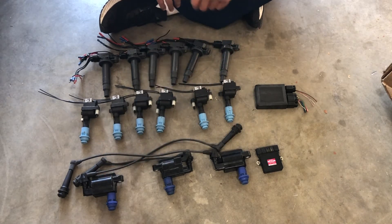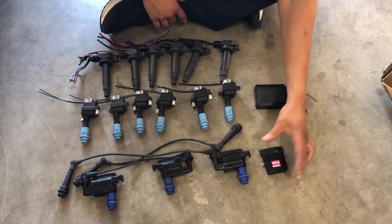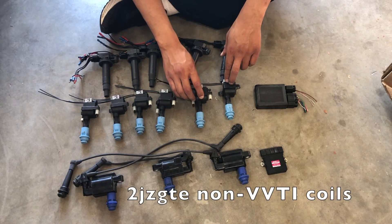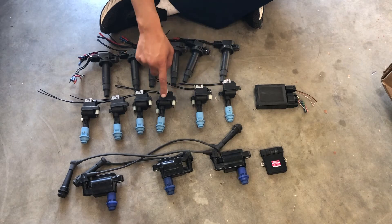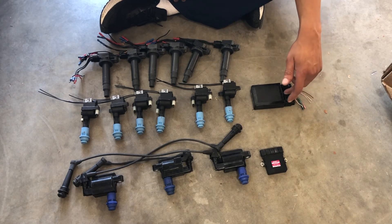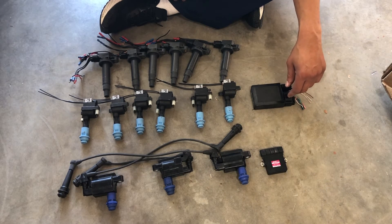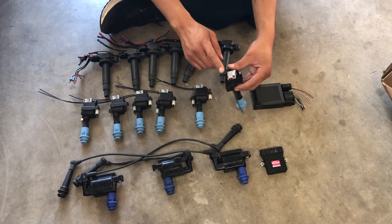Overall it's a pretty good, pretty cheap setup. These are eBay coils that have worked great — I picked up all three for about $35, and found the igniter on eBay for around $60. The next option is the 2JZ GTE coil setup, which only comes on the GTE non-VVTI version. There's one coil per cylinder — six cylinders, six coils — and it also uses an igniter that provides a tach signal and IGF signal, same as the first option.